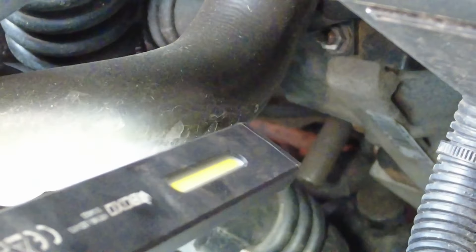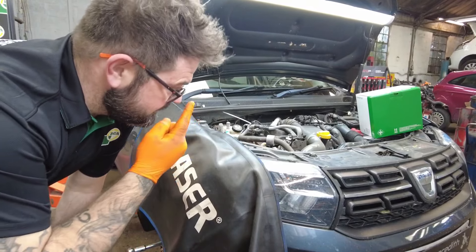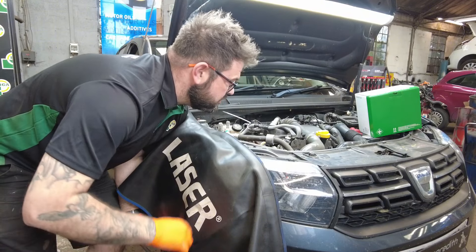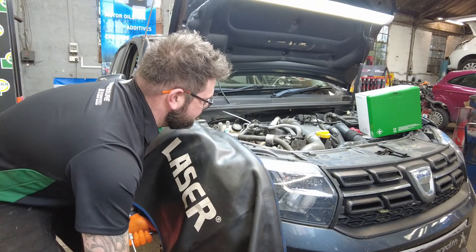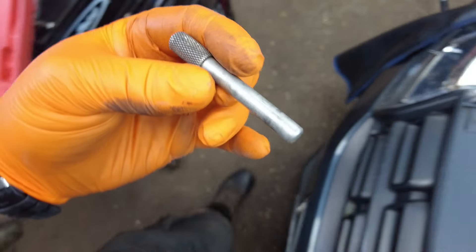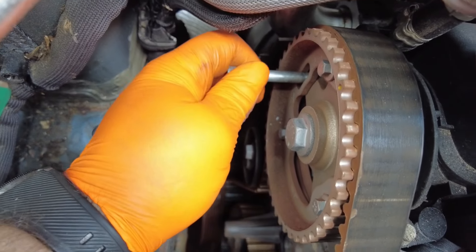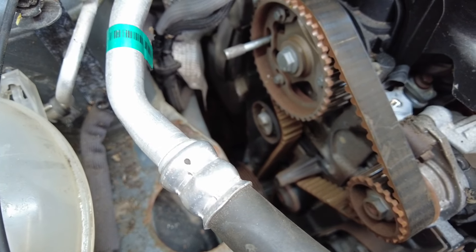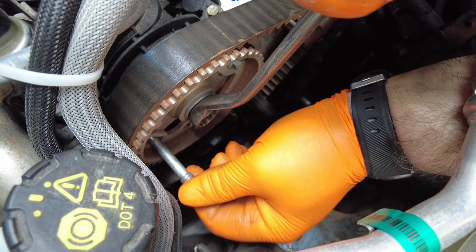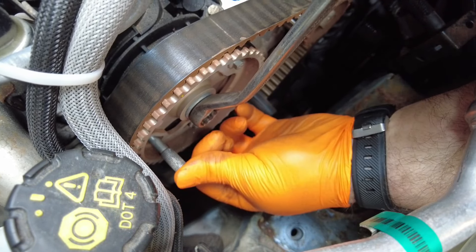The crank locking pin is right by there, just next to that intake pipe. What I'm going to do is turn the engine over now and get that locked up first. With the crank locking pin in place, we can jump on with an 18mm on a long extension on the crank pulley and get it locked up — just turn it over and you should see or hear the engine lock. That now is perfect. We can grab our camshaft tool and slide it into the cylinder head. It's probably because the belt has stretched a little bit — we're going to have to do a little bit of fettling. I'll grab an 18mm spanner, turn it ever so slightly, and that now is locked in perfectly.